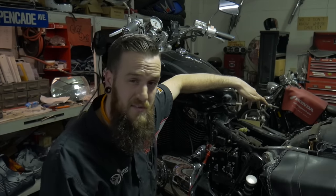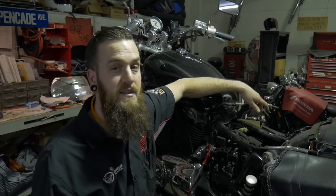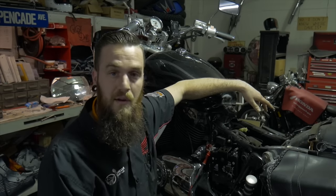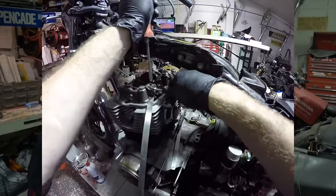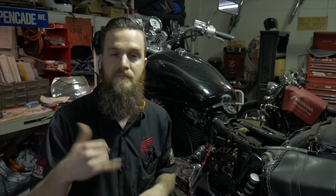I hope you guys find that helpful for your charging system issues. There's no real reason to pin out or probe the regulator rectifier — it's a sealed unit. You can't fix it even if you knew what was wrong inside; diodes burn out and there are transistorized components in there. Just put a new one on. If you haven't already, check out the Inner Circle — tons of detailed videos that don't make it to YouTube, where we really dive into members' bikes and break down fundamentals. Thanks for watching — like, share, and subscribe. This is Cody from Motorcycle MD, take it easy.